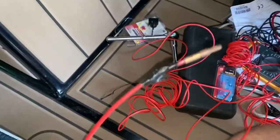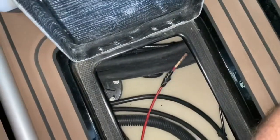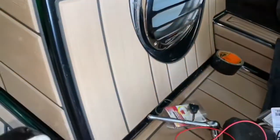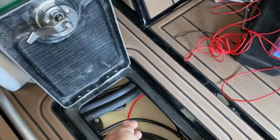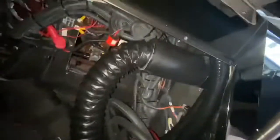I'll take my fish tape — that's what this thing is called, kind of a coiled-up mess — but you can run that up underneath the dash here, then go underneath the front seat and pull it up. Then you attach your power wire to it and pull it back toward you. You'll need to bring two wires toward you away from the switch. I found it was actually easier to go from under the dash.